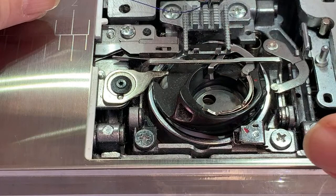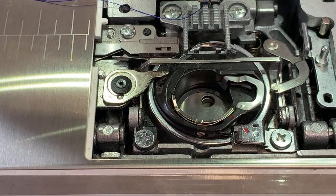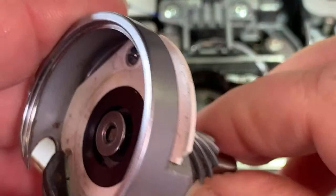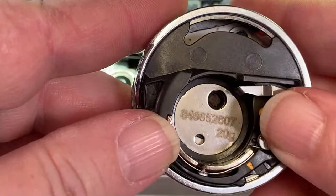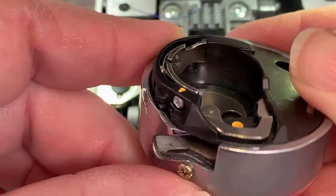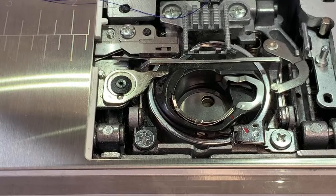That's why it's very important to clean up underneath the bobbin case. My husband often calls this area the cotton candy machine, because some people don't clean enough underneath here, and there's enough lint and fuzz that it looks like a cotton candy machine at the fair. That thread has to do extra work to pull each stitch. Sometimes if there's a lot of lint, every time that stitch goes around the bobbin case, the bobbin case will lift up a little, and if it lifts enough it will rotate on you. Nothing good happens when that bobbin case comes out of place. The oil is going away anyway — lint in the machine is absorbing the oil, and oil can be dripping off parts into the bottom of the machine. So very important to still get it serviced, even if not used much.